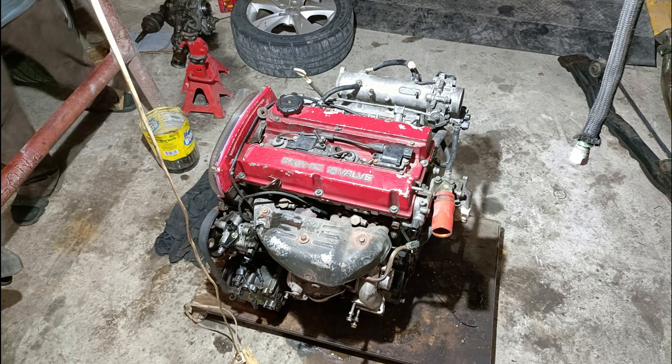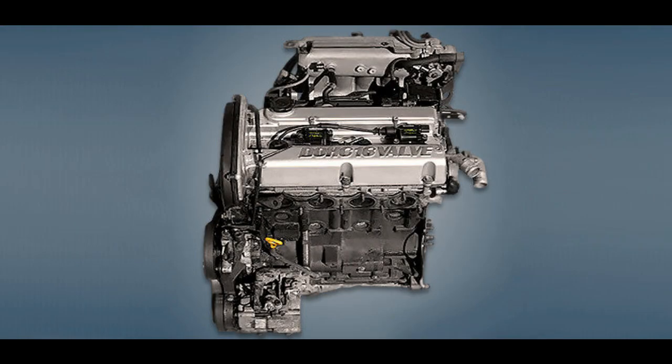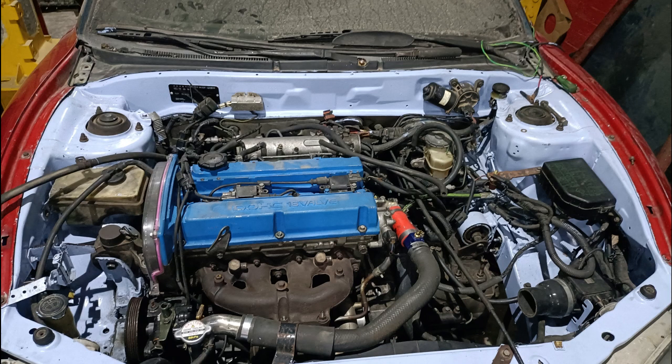The EVO 4 was the last 4G63 with the integral thrust washer and main bearing assembly. The EVO 5 to EVO 9 engines already use the split main bearing thrust washer. Thankfully, the Series 2 Hyundai engine, the G4JP, is also a split thrust washer setup. However, we still need to make sure our engine is getting enough lubrication, so there are about 10 things we have done and are currently doing to ensure our engine is lubricated very, very well.